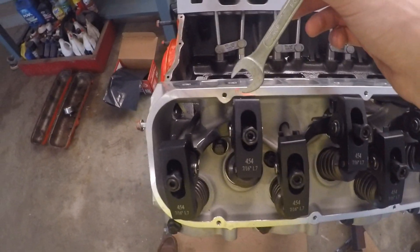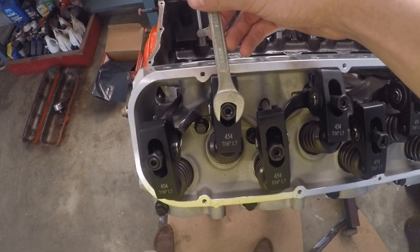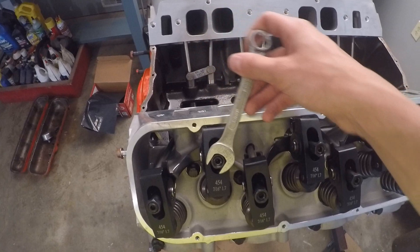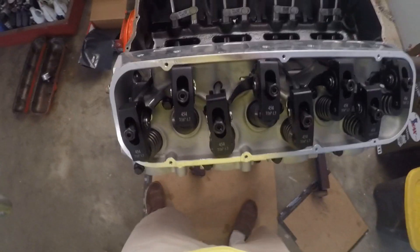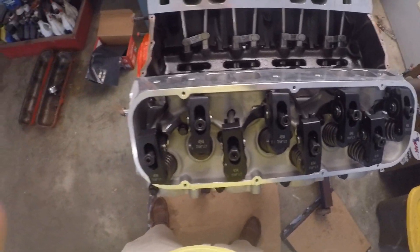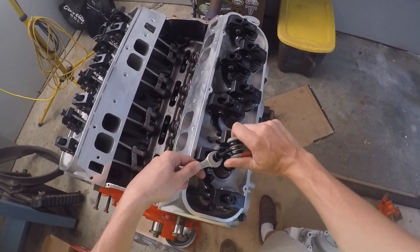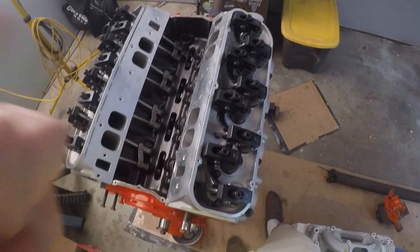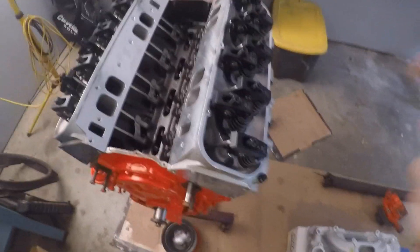For these hydraulic lifters — and about any other hydraulic lifter — a half turn on the rocker nut is plenty to set lifter preload. Now that I've got cylinder one's intake rocker at zero lash, slip your wrench on it, put it at around 12 o'clock, and then put one half turn on it. Then while you're still holding it, come grab your Allen key and tighten the polylock. It does need to be very tight since it's under spring pressure.